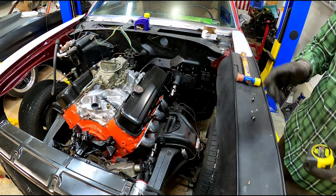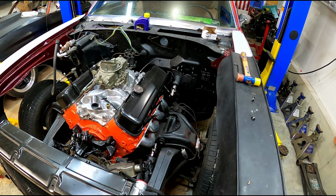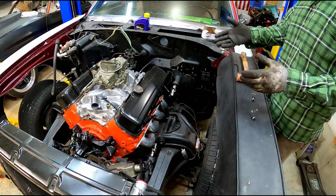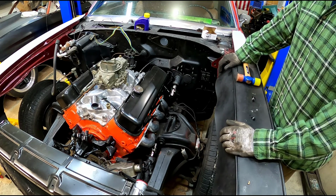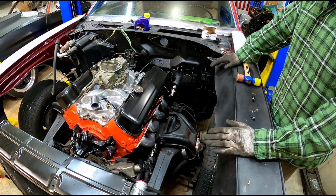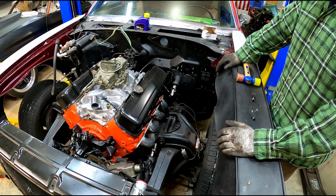Now that's just inside to inside. And you're going to want to measure yours so that you know specifically what length you want it. And also now you need to keep in mind the engagement that you want on either side of the shaft so that you make sure that it fits. But we know we need it 14 inches plus the engagement for each side.